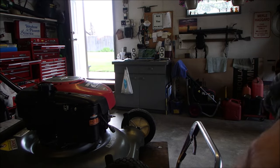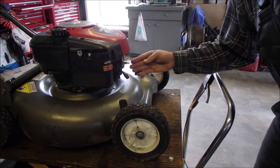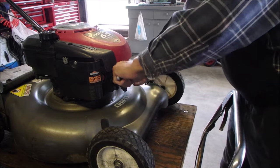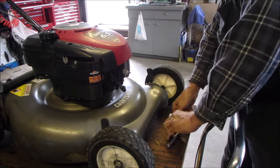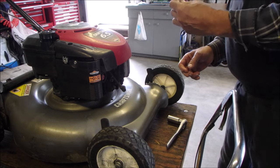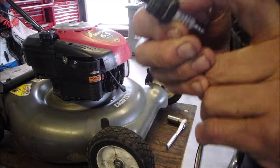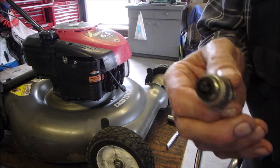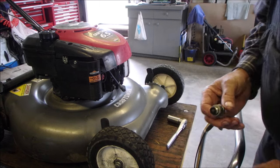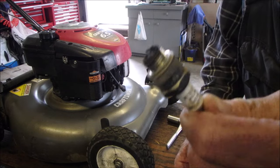Now I have friends that change plugs every day, right? Do it this way? Yeah. We'll just have a look at it. It might never have been out, you know. Well, it looks pretty good. I'm going to clean it up. It's got black paint on it, which means it's the original plug to the engine, and it's a 2004, which makes it a 20-year-old machine with the original plug. Quantum, baby! And that's a flathead, which means the valves are in the block. So that's burning pretty clean for a flathead.